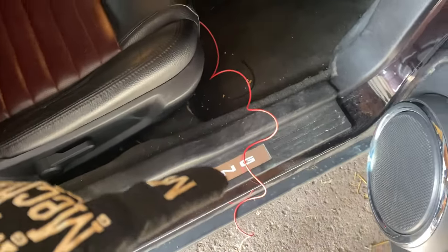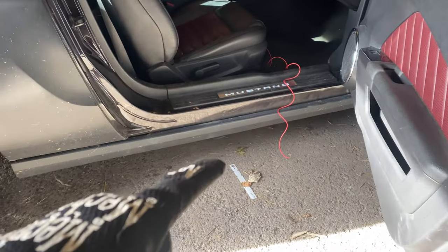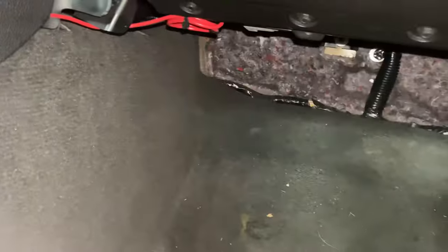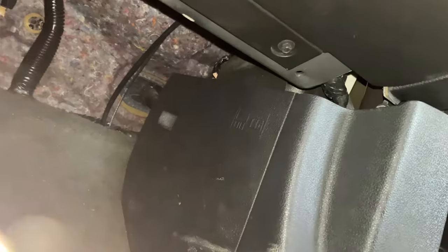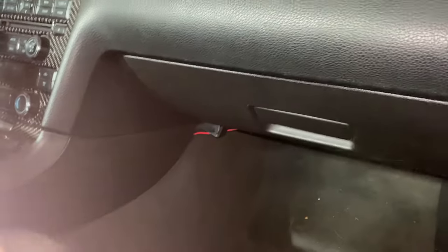Next thing is this wiring that got undone from when we did the steering wheel. I'm going to redo that wiring today — I have to cut it a little short and then use the same fuse tap I used last time. I'm going to make sure it sticks this time, and I'm also going to use zip ties so I can put it up out of the way and tuck it away from anywhere it might catch on someone's feet. All you can visually see from inside is that little red corner there, but I got it all done — steering wheel works.